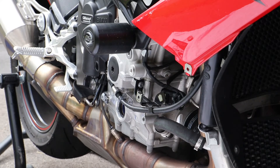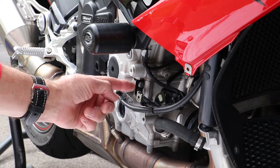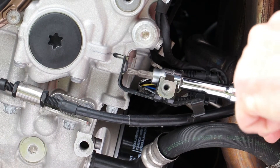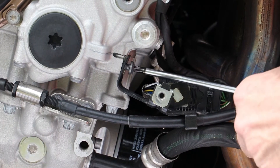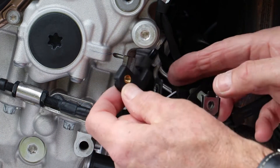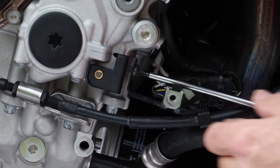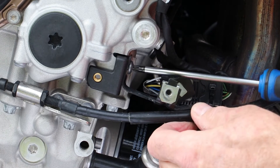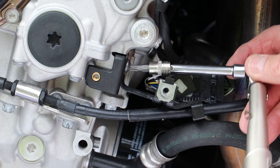The pulse cover required a bit more effort as first a new bracket had to be fitted. There is a bracket holding the clutch cable, held in location by a screw which I removed. This didn't come out particularly easy — it almost felt like it was corroded but the threads were pretty clean. With the screw out of the way I inserted the new bracket, repositioned the old bracket, refitted the original screw, and re-torqued it to 10Nm.